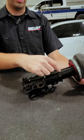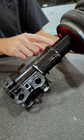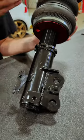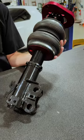All of our Performance Series struts and shocks will have an adjustable lower mount on a threaded body monotube damper. This allows you to thread this lower mount up and down to change the mechanical height of the overall strut.